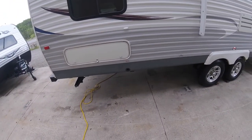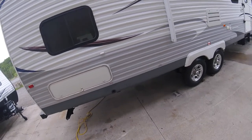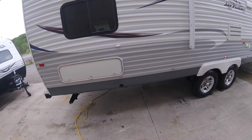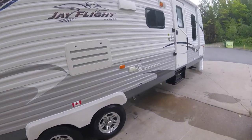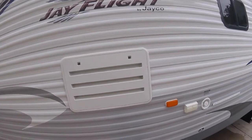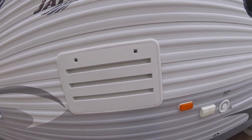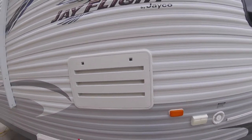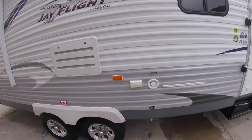On the door side at the back, you have a hole in the side for your spare tire crank — it uses the same handle as the stabilizer jacks. Next is the fridge compartment. Everything's controlled from inside, so it's really only for service and airflow. You can't lean anything up against the trailer to impede airflow in the vents; otherwise it affects the cooling performance of the fridge.